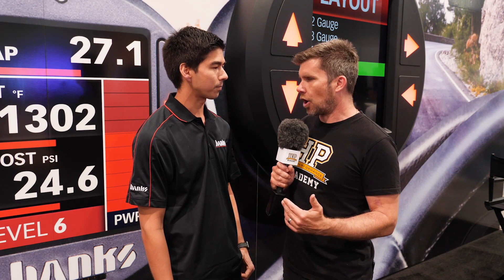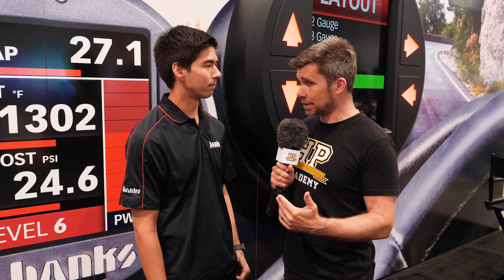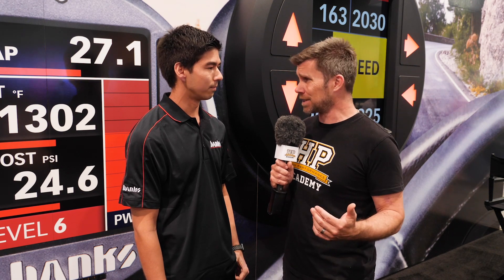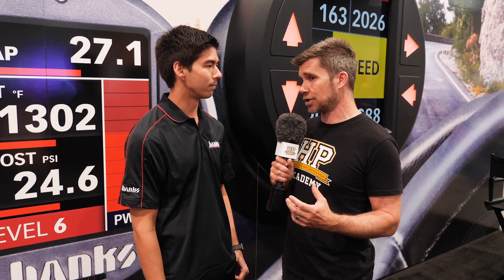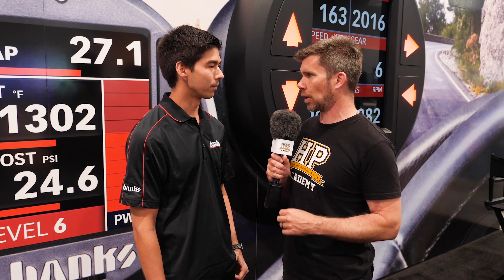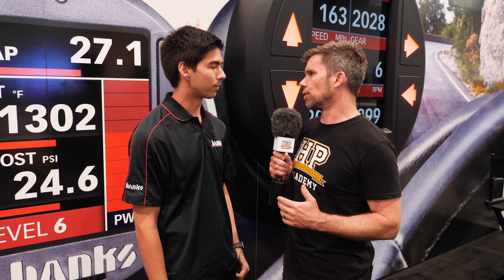But it's definitely not user friendly. We've gone through that with our own development vehicle — particularly from our side of the world we have to send the ECU all the way to the US. It's also an incredibly expensive process where the factory processor is actually removed from the board and then replaced with one that's programmable. So let's talk about your alternatives.